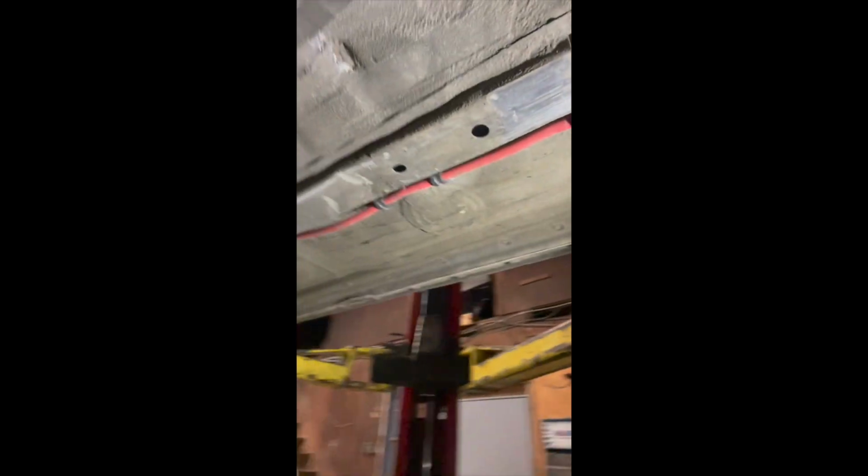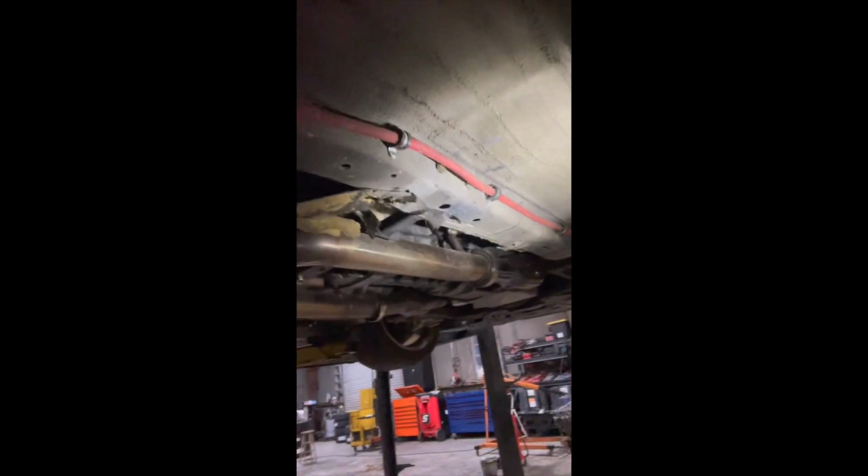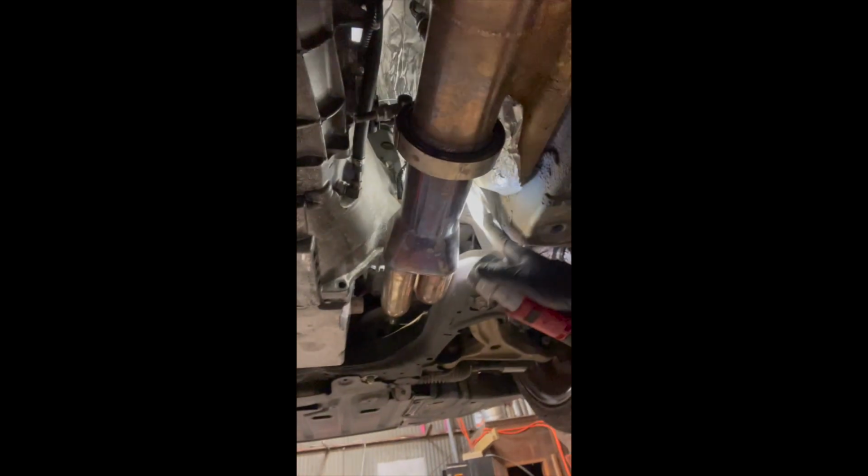And so for the battery cable, I went through the little cap for this side of the fuel hat, and I put a grommet through for the battery cable to run, and I go along the frame right here. I just use some sheet metal screws to go along the side, and then I use some heat shield to prevent the exhaust from heating this up and melting it. And I actually put a bolt right here in order to hold it away from the header.